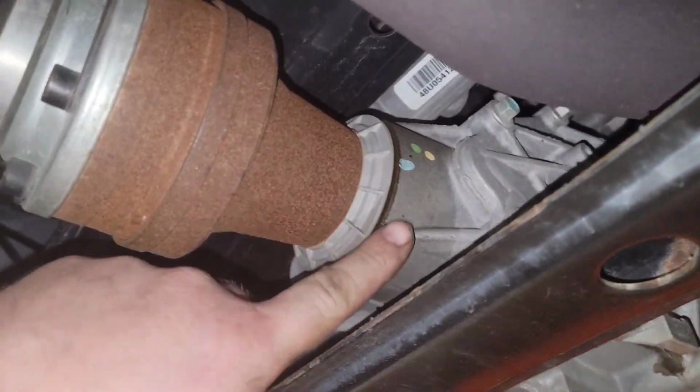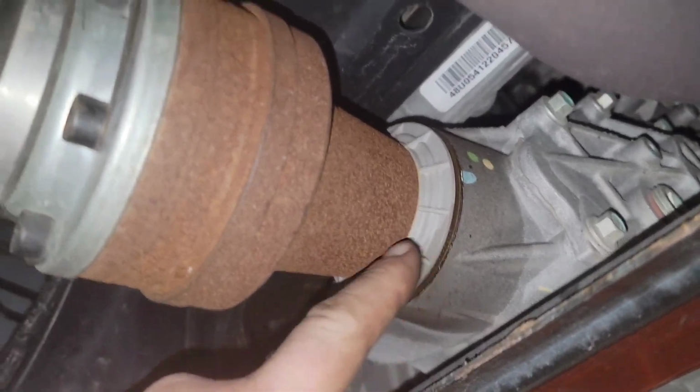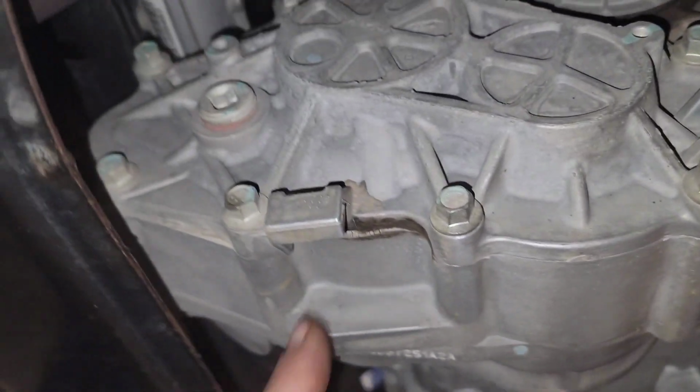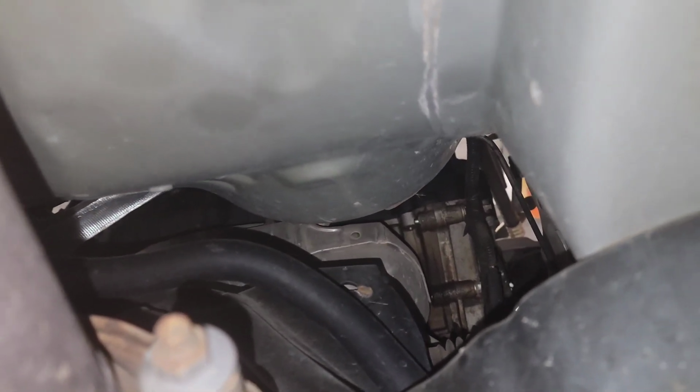you know, we get a little bit of moisture coming from here. It's not quite seeping yet, but it is starting to get a little bit of moisture around this seal. That's kind of normal. Depends on how the vehicle's been being run. That looks old. No other leaks down here that I see, but it's going to be an expensive job to reseal this motor, so do the valve cover gaskets while you're there, front cover gaskets while you're there, oil pan gaskets while you're there, fresh oil change.